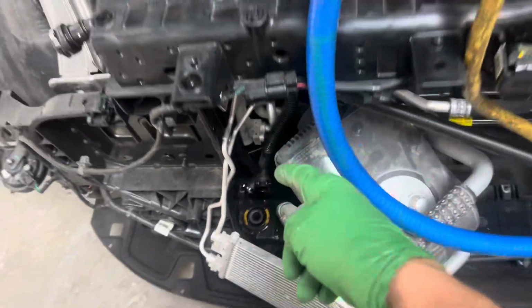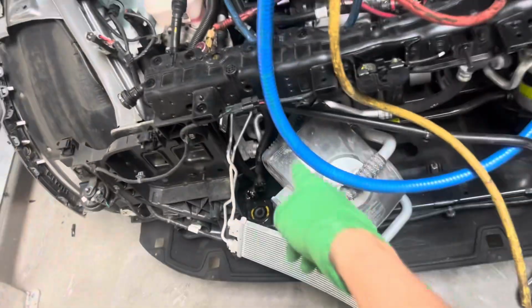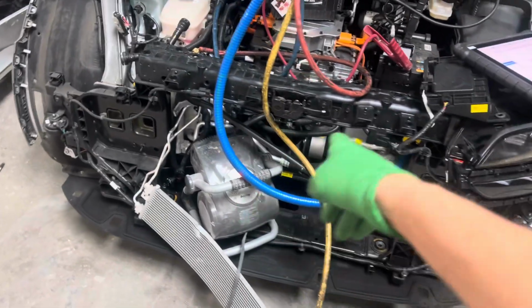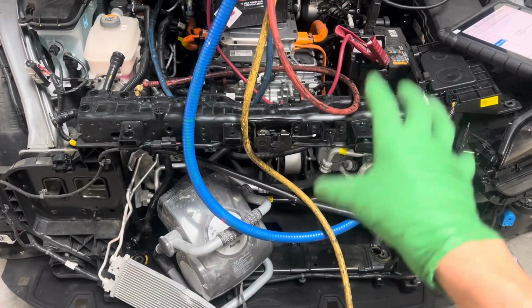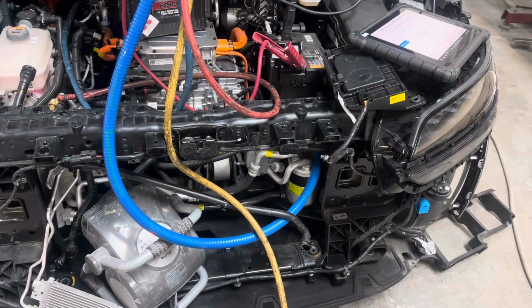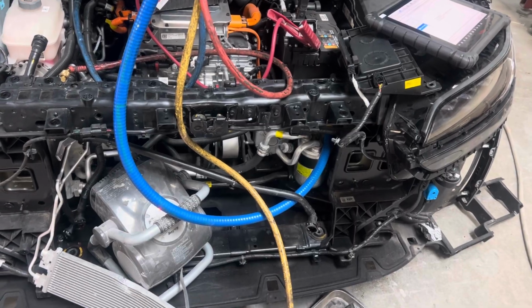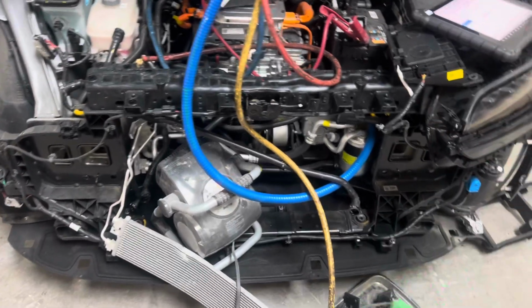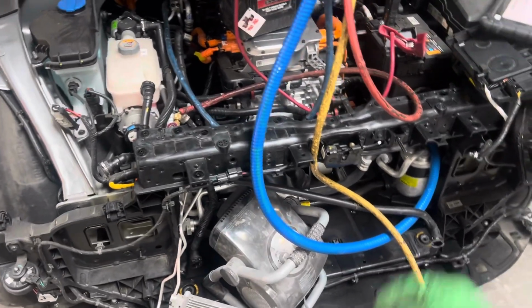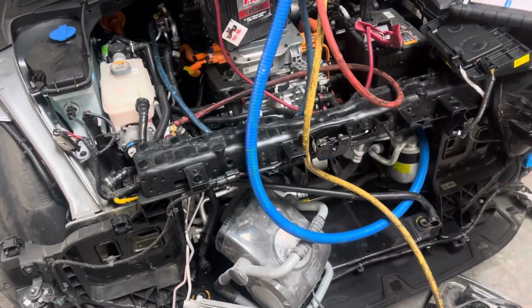For that plate heat exchanger assembly, that's a $3,000 unit right there. And for those guys who burn up a $4,000 compressor, because say this vehicle gets taken down to Joe Blow's shop down the block to do AC on it, and it's hit, they replace the accumulator. They don't know it needed maybe 3 ounces inside the system, and that is not the condenser, and they don't know about the oil capabilities. They burn up a compressor, metal flake the whole system, boom, $10,000, $15,000.